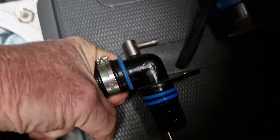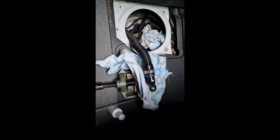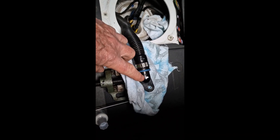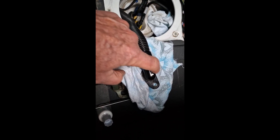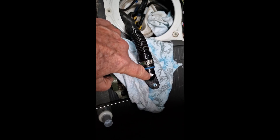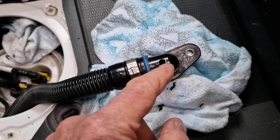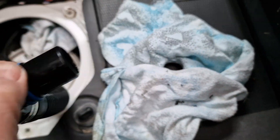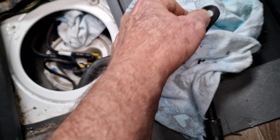I'll go slightly off centre to accommodate the top bend. The breather pipe can put up quite a fight, so I've clamped it and marked it on the top where I'm going to drill. It'll be a 6mm hole, just off centre towards the rest of the pipe. The hole is drilled neat and clean — all the swarf is cleared out, no contamination.